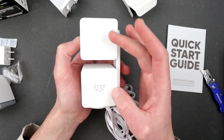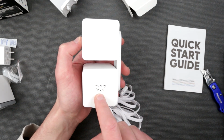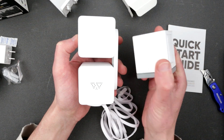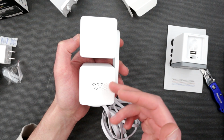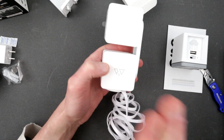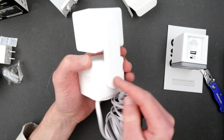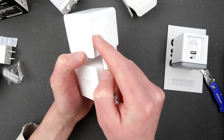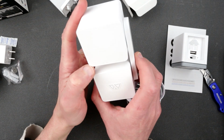So it looks like the camera consists of 2 pieces. I thought it was going to be just motors in the base and the speaker would be here, but no, they moved the speaker, if you compare it for example with this camera, from the camera module itself to the base. So the base is highly likely to contain the pan motor, and the top contains the tilt motor, because obviously this part is fixed. So the top motor is in here, and the bottom motor is in here. We're gonna take a look at that as well.